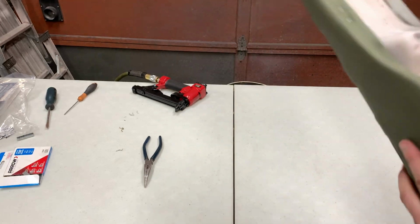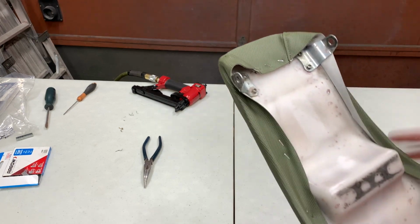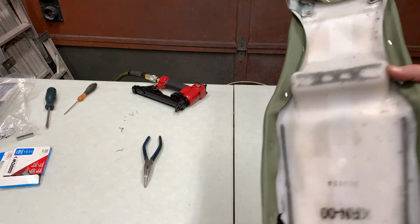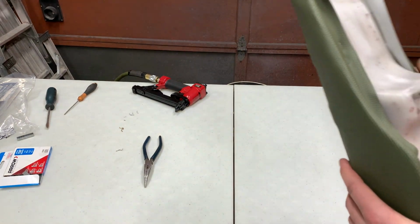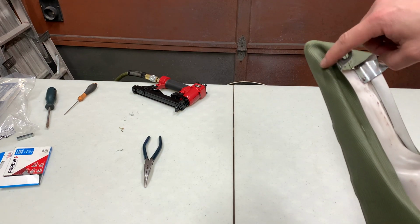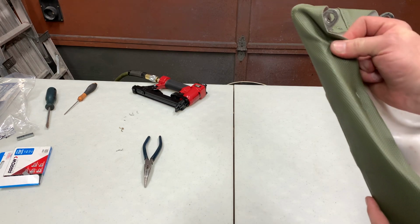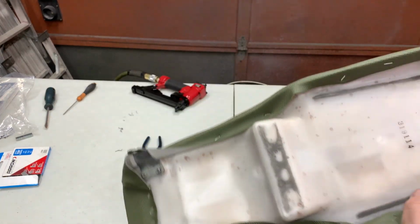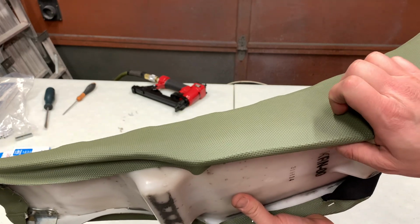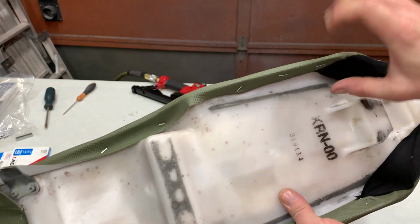But I think what I'm gonna have to do is, for this particular seat cover, it's not perfectly tailored. They've done really good, don't get me wrong. The Thrill Seekers did a really awesome job at making this seat cover for the 04 CRF250. But you're just gonna get these little things here. You're just gonna have to cut these a little bit, and then you'll have to pull these tight. And when I'm pulling these tight, you guys, I grab the fabric with my hand like this, and I grip it, and I use my thumbs, and I just really pull it as hard as I can.